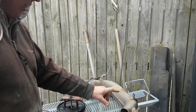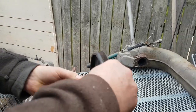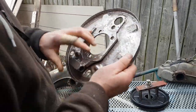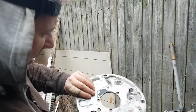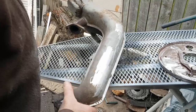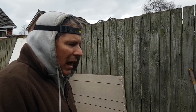Here's the next load of parts. These are called the heat exchanger — there's the left one and the right one. There's the pulley — I made a pulley extractor. Being a toolmaker I just knocked up a bit of a thing and you can pull them off. Don't put aluminium ones on, keep to the steel, because aluminium can pick up and destroy the engine. There's the right heat exchanger — I'm going to clean all these up and paint them gloss grey. We're off to a swap meet tomorrow so I'm going to ask them what the grey is called, to get roughly the right colour so it'll pop.